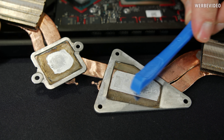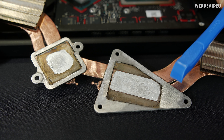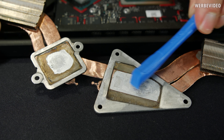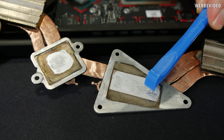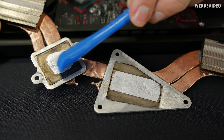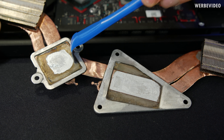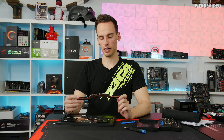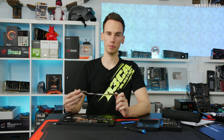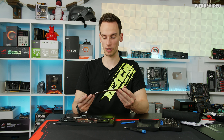As expected, as long as the heat sink is not removed you can't see anything. After removal, you can see there is not much liquid in the liquid metal — it looks pretty hard. It basically looks the same as if you would apply it to naked copper and wait this long. The same applies on both the CPU area and the GPU area, though there's still a liquid part on the left side of the GPU. Unfortunately, this means our DIY nickel plating was not successful — it's 100% the identical result to just applying liquid metal to bare copper and waiting about half a year.